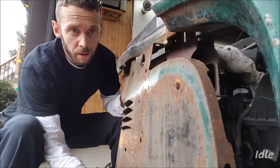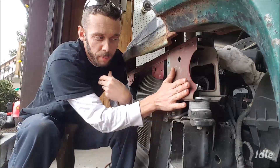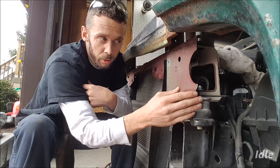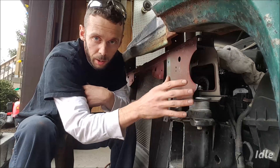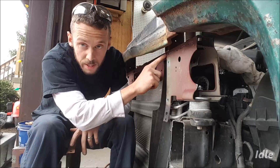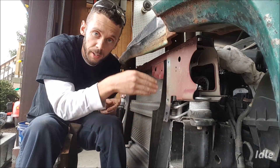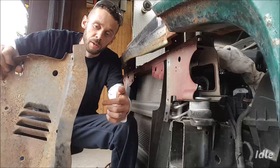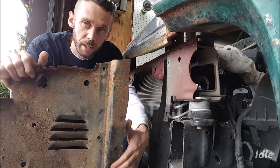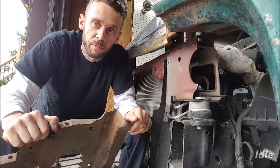This piece should fit in there now. Got that cut flush — still have to cut this hump out, but we'll address that whenever we clean up this whole corner. One thing is this has a cross piece here where that original U-shaped core support fit, and it was just straight. This has a lip on it that the cross piece would hit, so we've got to cut a notch out for that and then we should be able to see if it fits up in there.